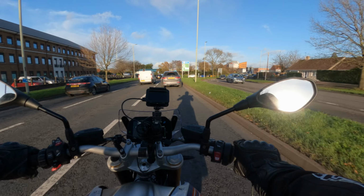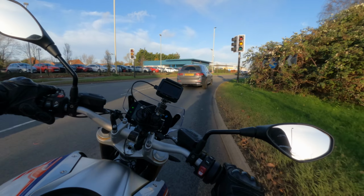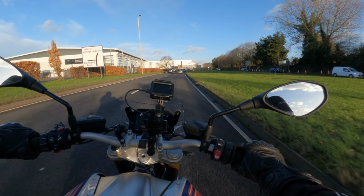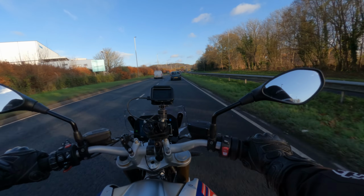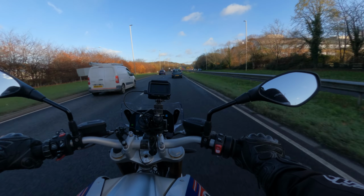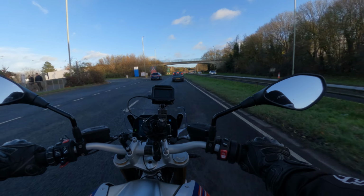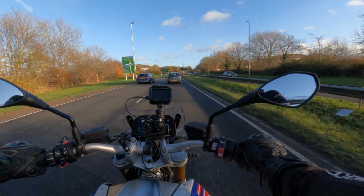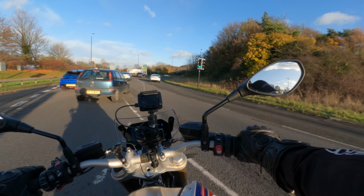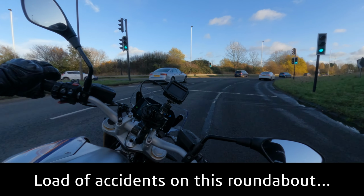This bike can lift the front in 2nd gear if you're a little bit rude with the throttle, but with that Leo Vince, even though I kind of sorted out the mid-range performance, the low-end performance suffered and it wouldn't lift the front. So yeah, that's the two aspects. A, is the performance going to be there in the mid-range? Well, between 5 and 8,000 RPM, a bit higher than the mid-range. Would it equal the OEM exhaust on time? And the other aspect is, does it pull properly if I give the throttle a yank in 2nd gear?